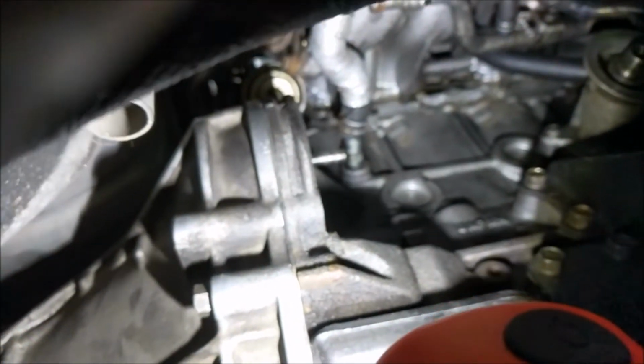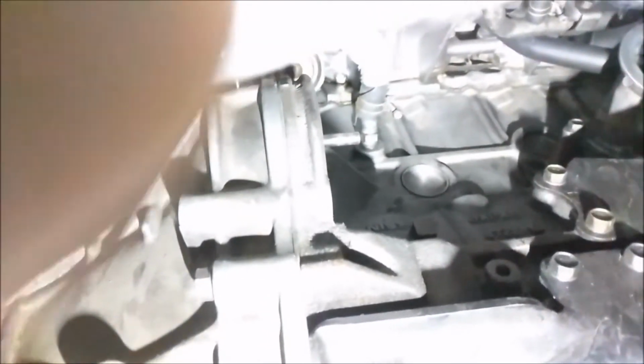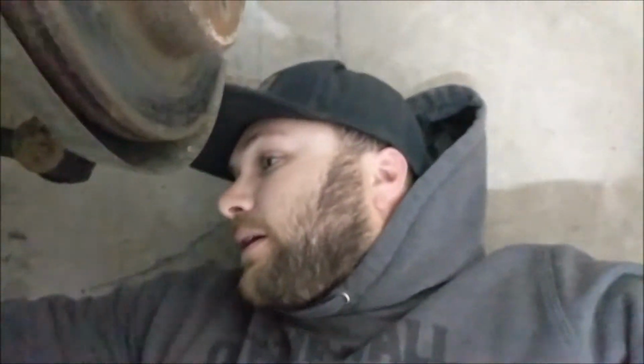You can see the drill bit up there. So I need to get my drill up inside there. Try to drill out those holes because for some reason the bolts won't go through it and bolt up the starter. So see what the issue is here. Get those drilled out. It should be good now. The drill bit kind of moves freely in there, or at least I can twist it in, so something's definitely blocking it, and I'm guessing it's the sandwich plate, so guess we'll find out.